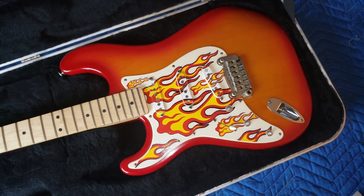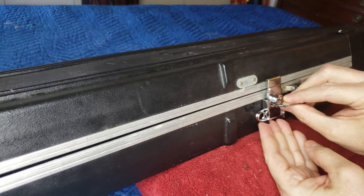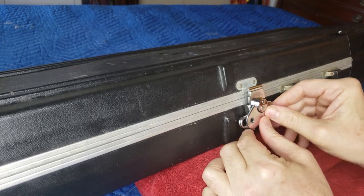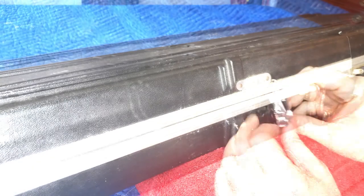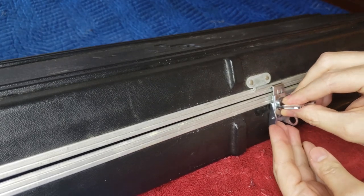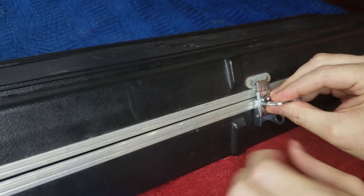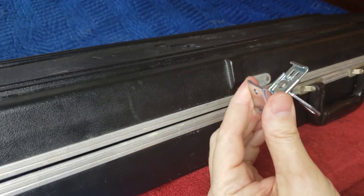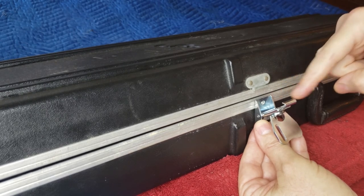So I think we are going to take a crack at saving this bad boy. At first I went out and I bought this particular latch, and this latch does fit under this metal trim — it will grab this when I close the latch. I'm going to have to drill this piece of plastic out. Here's the problem: this latch underneath does not reach. What I have to do is lay the latch on top here and drill into the plastic, which isn't that much of a problem, and this latch does fall back on its own easily. But there are only two holes in the latch, and one of them would have to drill right through the metal trim, which I don't want to do.